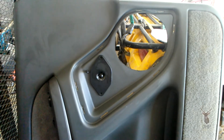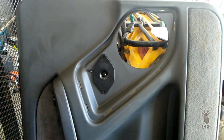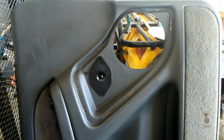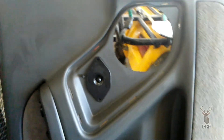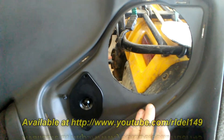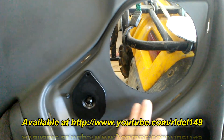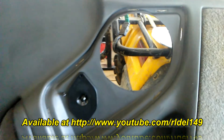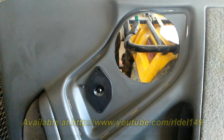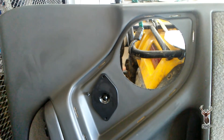When I read reviews, sometimes people say a speaker just doesn't have enough bass and they're disappointed. When you're replacing a factory speaker, it helps to know what you're doing. A lot of head units are 4 ohms, like the one in this truck. This speaker is 4 ohms, the speaker I pulled out was 4 ohms — so if I replace it with a 4-ohm speaker, I've done exactly the same as what was there before.